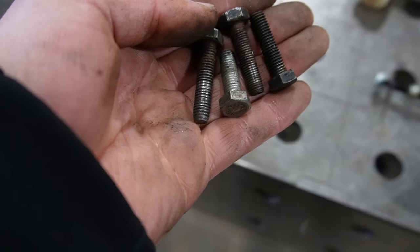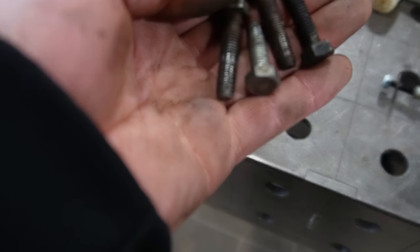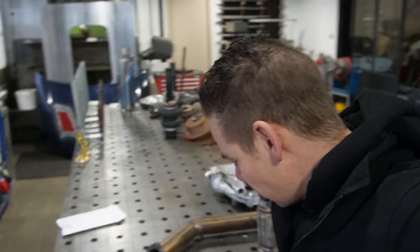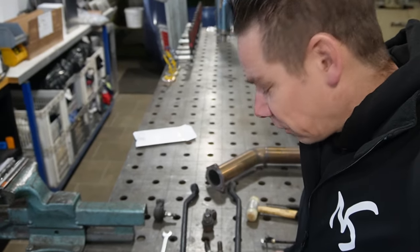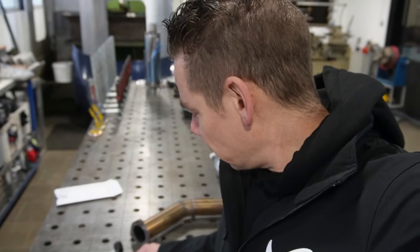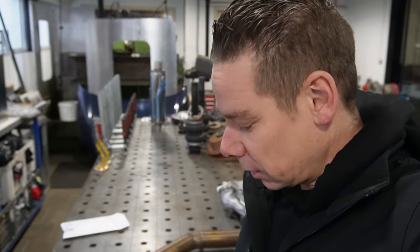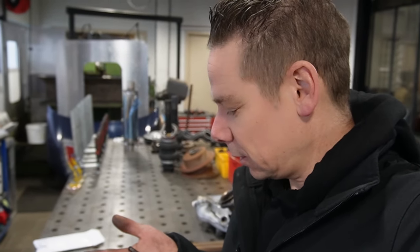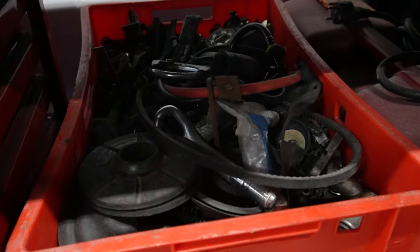As you see how damaged the threads are, it was not working, so there was a wrong bolt in there. Surprise, surprise, surprise! So in the steering arm there's fine thread in it, and in the steering joints there's a bigger thread. So I need to figure out a new bolt. And remember that we changed that out. Oh, it's on camera. Better safe than sorry.